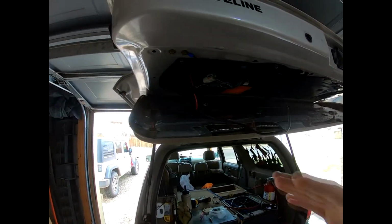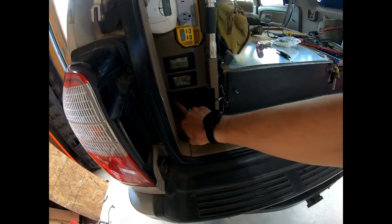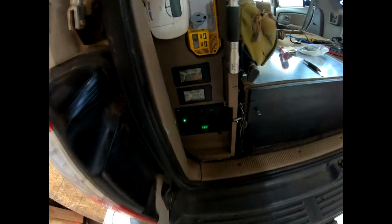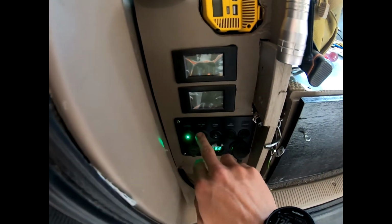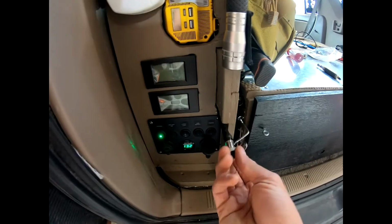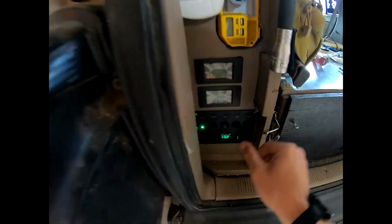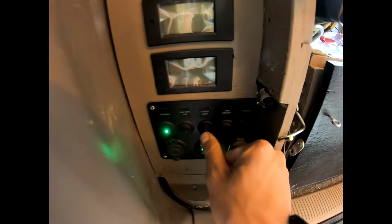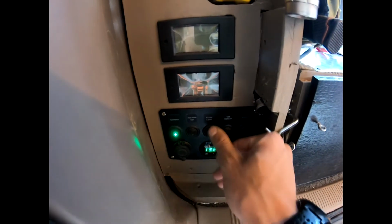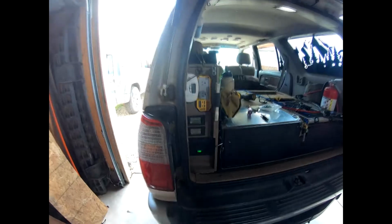So with that in mind, just understand that's how this switch works, right? So right now, clicking this first switch, I've got power coming in to all of these switches. So fresh water, here's my fresh water line. So I power that, and that plugs in right there. So we don't need him. But this backlight here, so up fires up the white light, all the way down fires up the amber. So basically what this is doing is there's 3 contacts in that switch. The middle one is where your positive goes.